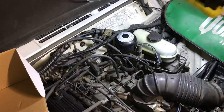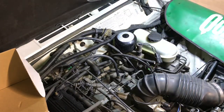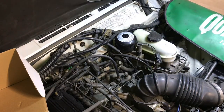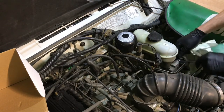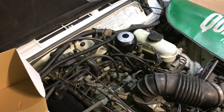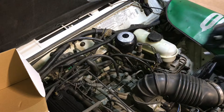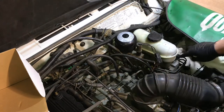That's the line going to our pressure ball — I might just pull that to the side for now. I'll get the hose off the reservoir and pop these lines off. I put a rag down here to catch any brake fluid — you definitely do not want to get brake fluid on paint; if you don't know, it is very corrosive.